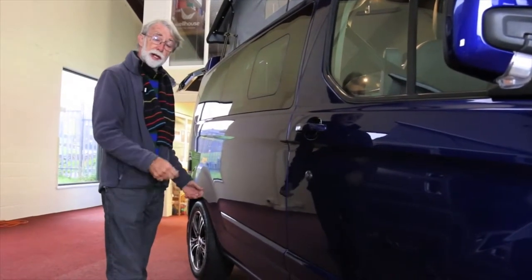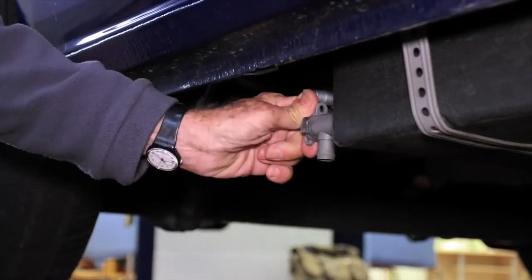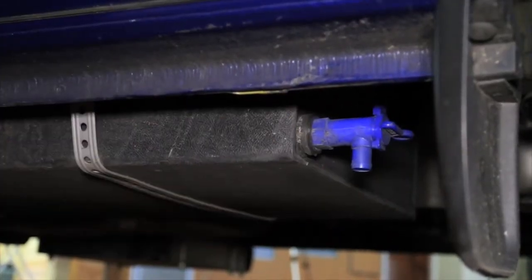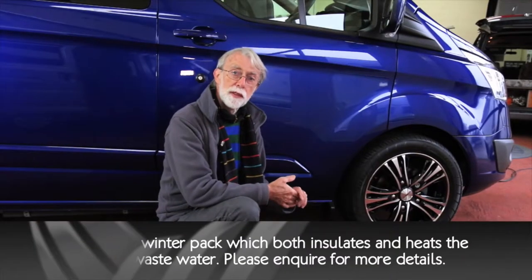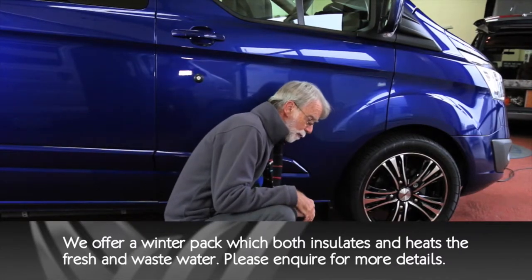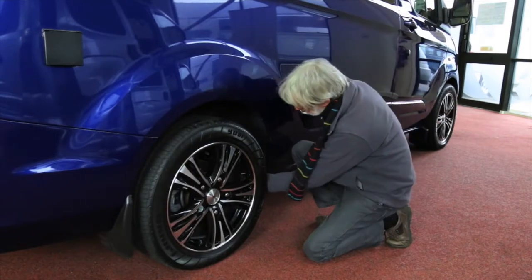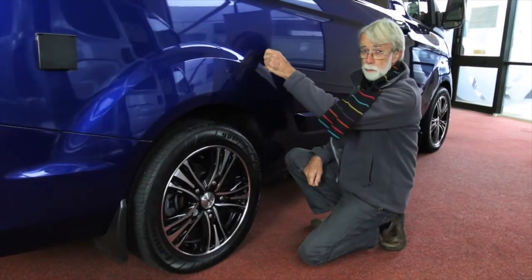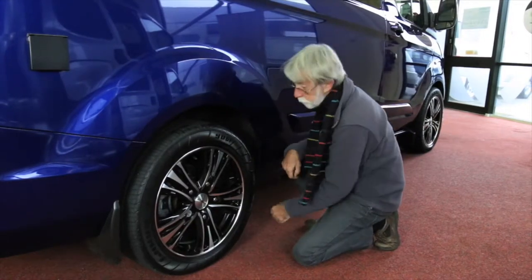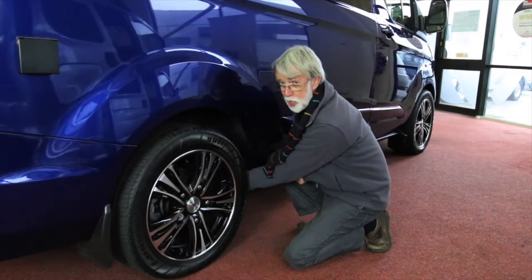There are three water taps under this side of the vehicle — they're colour coded. Blue for fresh water, grey for waste water. To drain the waste water tank, simply find the tap, turn it and discharge the grey water. Just behind the front wheel is the drain tap for the fresh water tank. Normally you won't be too concerned about that, but in icy weather you will need to drain the fresh water tank — you can't put antifreeze in your drinking water. Open the tap and the water all drains out. There's also a tap just in front of the rear wheel, and it's very important in icy weather to turn it to drain the pipework, the electric water pump and the tap itself — if ice forms in those components it can cause a lot of damage. When you refill with fresh water, sometimes the water won't come out of the tap immediately. That means there's air in the system, and you can easily bleed it by flicking the tap on and off a few times.